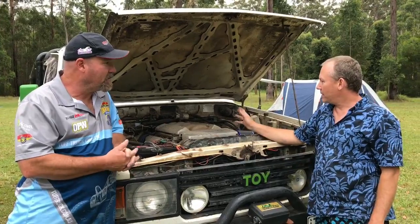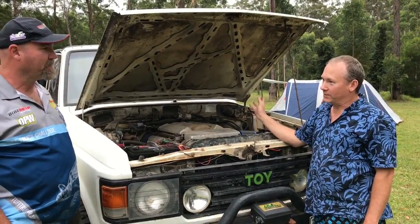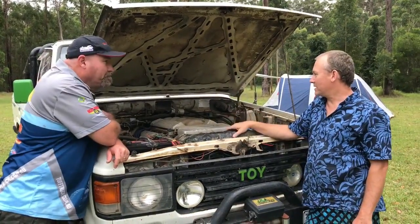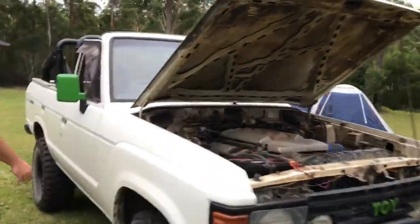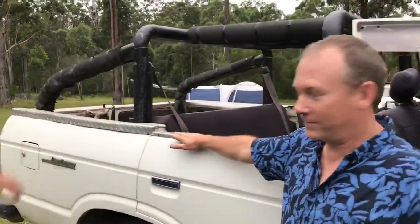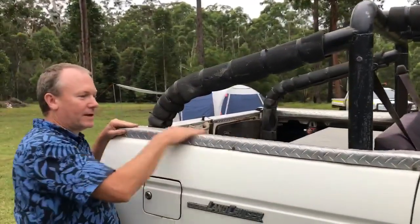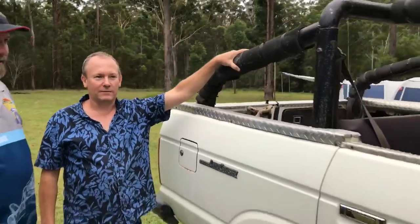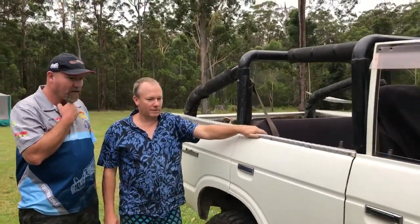After about 2008, it was onto a second roof because of rust. The old 60s are prone to that. This roof was starting to rust out, so I came home from holidays one day, got a black texta and walked around it just by eye. Then the next day it was with an angle grinder, going all the way along following the lines of the vehicle. Then fabricated the alloy sides for it. We've got a roll cage engineered - this is engineered for eight ton - bolted it all together, so it's all engineered. Road registered, road legal for New South Wales.